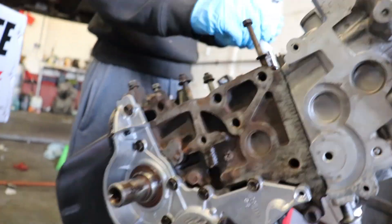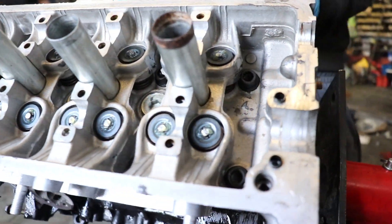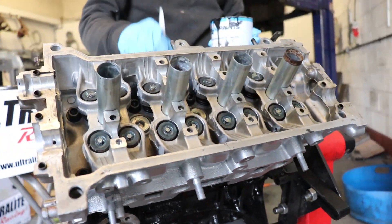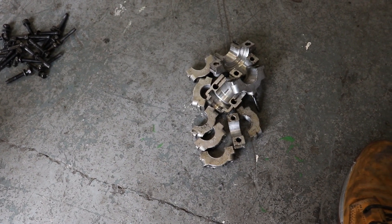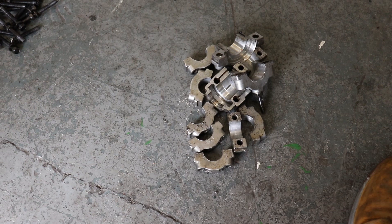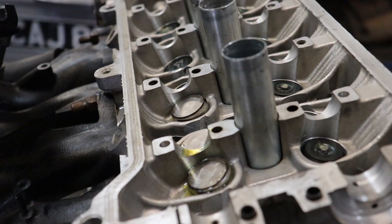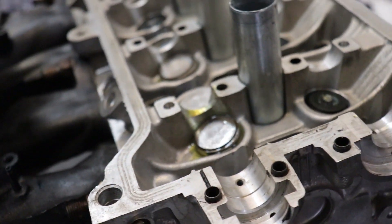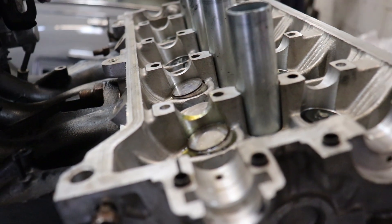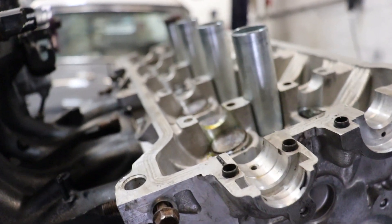My brother's put the sump on and is painting the engine block. Next we've got to put the cams in and put the shims in — make sure all the clearances are correct. It's day three of the engine build. We've got a lot of cleaning to do on parts: the cams, the cam caps, the rocker cover, alternator, and all the covers. Now we're putting the shims into the head in the same order they came out, using a scrap head to keep them organised. We're going to check the clearances after — you have to, so the top end doesn't rattle.